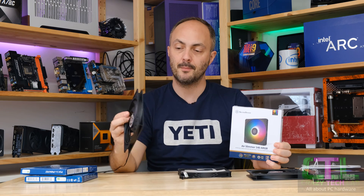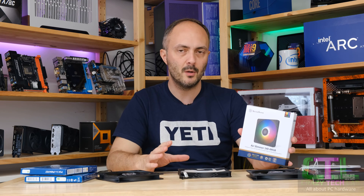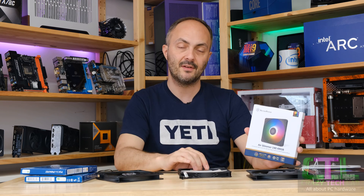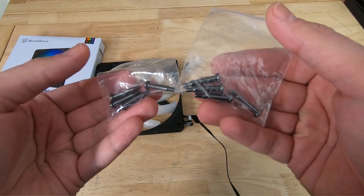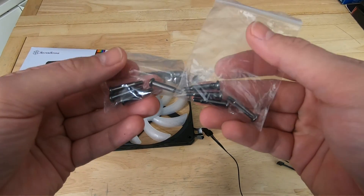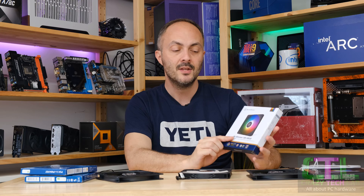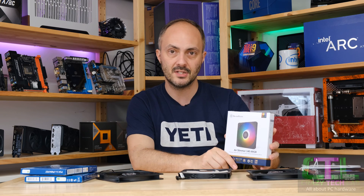The Arctic is basically a standard black fan but a lot cheaper than the Silverstone. So no real bad 140mm slim fans out there right now. The Silverstone just pips the others in terms of airflow, airflow-to-noise ratio, RGB lighting, and one of my favorite features: it comes with all the screws you need to attach it to both radiator thread types — specifically M3 and 6-32 — with the shortened screws needed for those fittings.